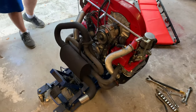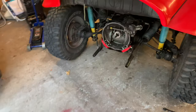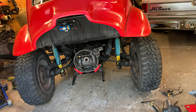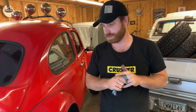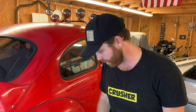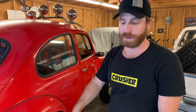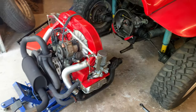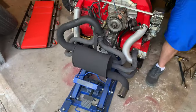He's been working on little stuff here and there because when it was sold and gone for 12 years, things didn't wear out — it just got old, sat outside as an advertising piece, and the elements weren't kind to it. Everything rubber on the car is rotten. My goal is to get it drivable first, then reliable, then cosmetics. So far: all new brake lines, new fluids, new seats, new engine, new transaxle mounts, shifter bushing, ignition switch. Next up is tires.